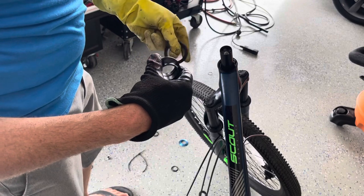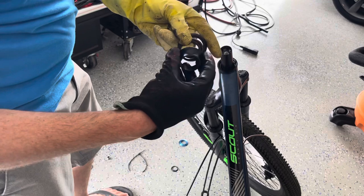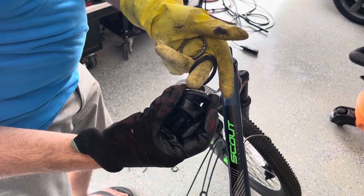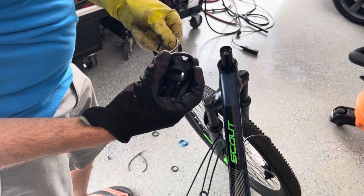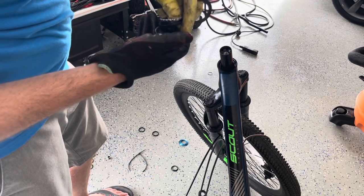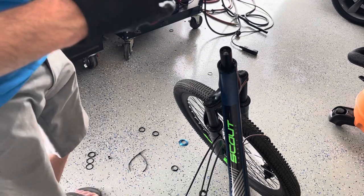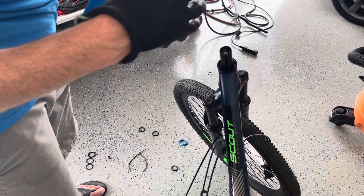So let's take this off — we've got to get that fixed. Upon inspection while I was taking this apart, you can see the order it goes: this is kind of the top cover, there's a little plastic spacer, and then this piece that fits into the bearing — it looks like that was upside down. So really there's no wonder why the bearing wasn't properly fitting and there was a lot of play or slop in the headset. While I have this off, I'm going to put some grease on the bearings because there's hardly anything on there.